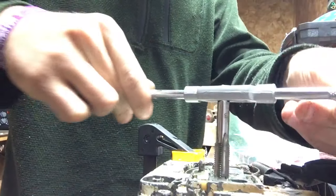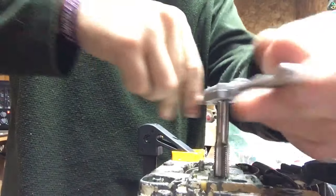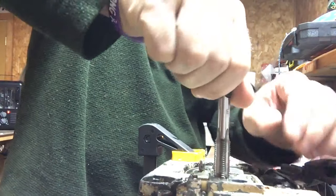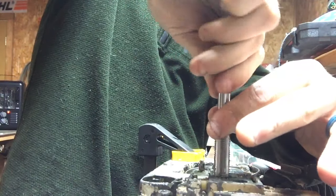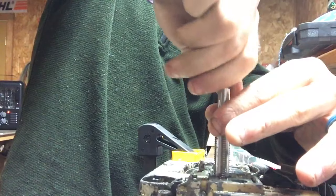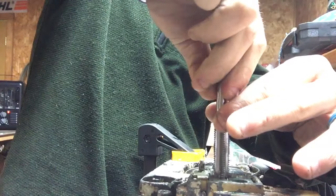And there are certain tools that you insert the coils with. Some just flat out suck. Some are okay. And some just still don't work right. Clean this out again. See, I gotta go the entire depth of the hole with the threads, so it takes a long time to get down there. You might not think it does, but it does.